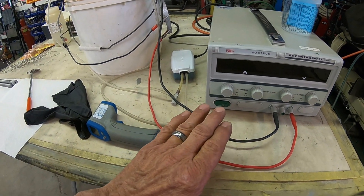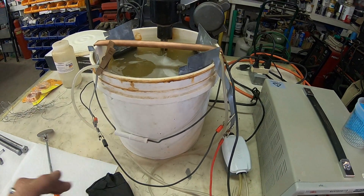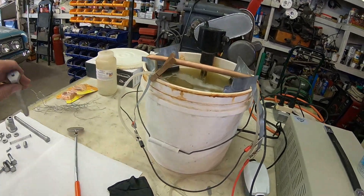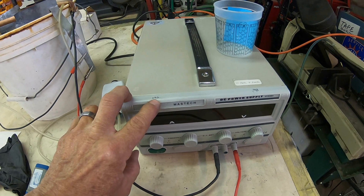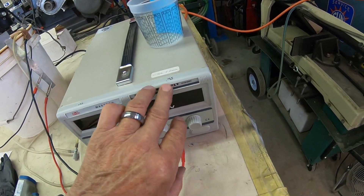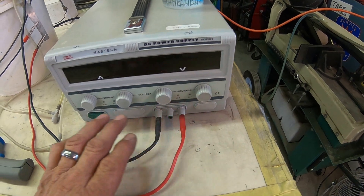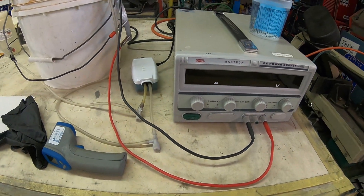Normally, for what I can fit in my bath — unless it's big items like these bolts — I try to run mine at 2.3 amps and 0.5 volts. So your voltage is about 0.5 and your amps is at about 2.3, and that seems to work good for me.